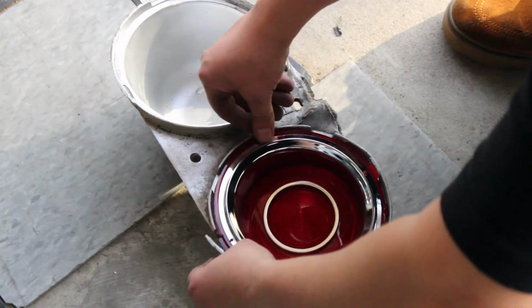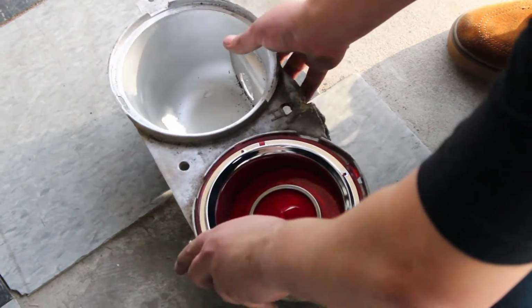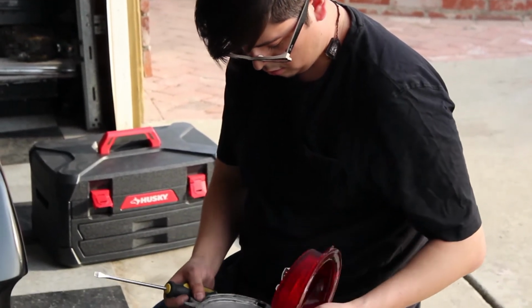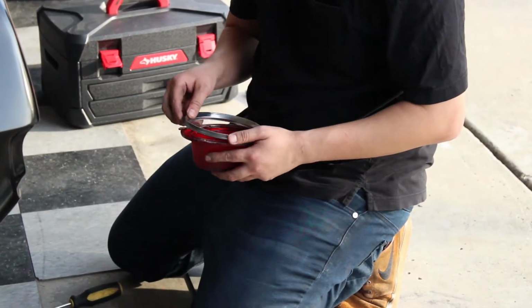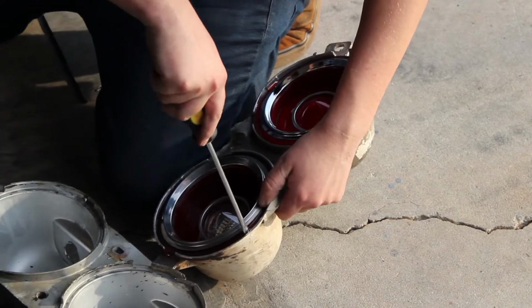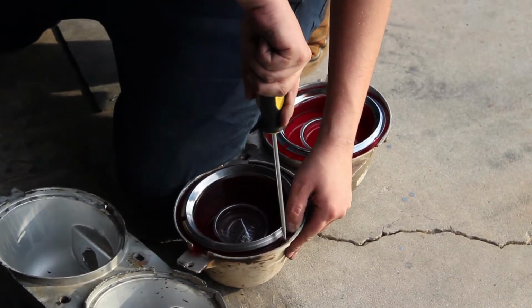Suspension so far, everything has been done on it. It's the aftermarket Hotchkiss front sway bar. We have the CPP upper and lower control arms. We have the Viking dual adjustable coilover setup for the front, and for the back so far we have Bilstein shocks and Hotchkiss Sport Leaf springs with the upgraded bushings that were in the kit as well.